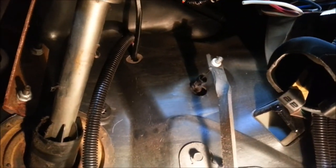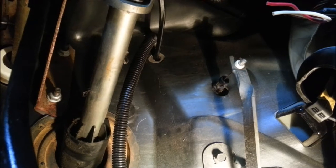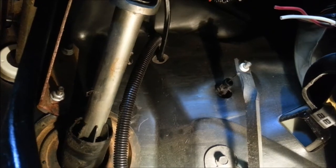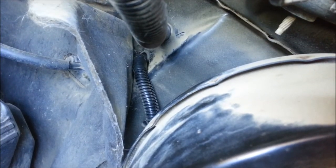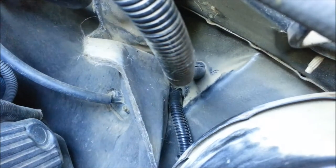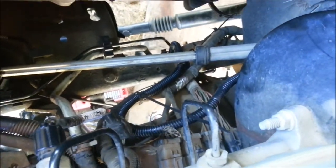I'll show you where I've got the wires going. I drilled a hole through the firewall — there's the gas pedal — and I basically drilled a hole through the firewall to run the triple wires for the sensors. I already had a larger hole drilled a few years ago for my amp, and then I drilled another half-inch hole below that, put a grommet in, and ran my wires through. You can see the new wire loom running through there.